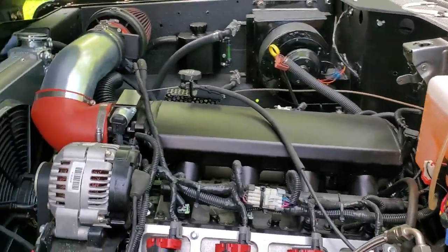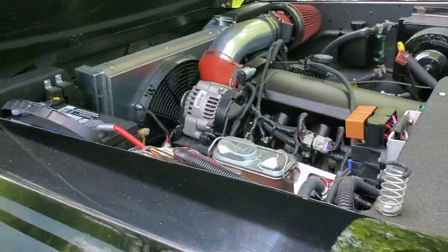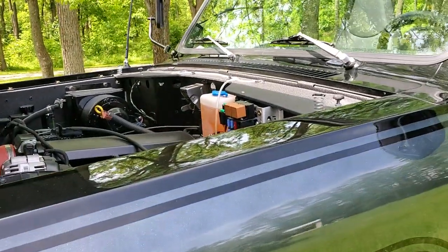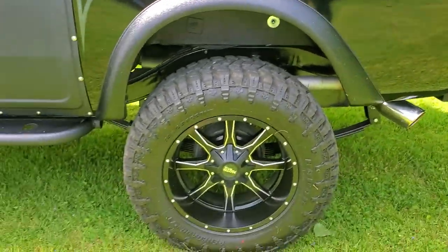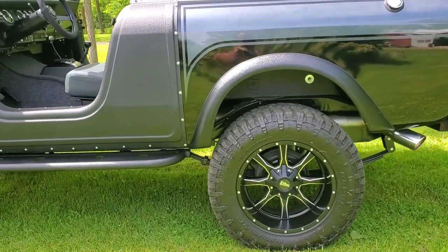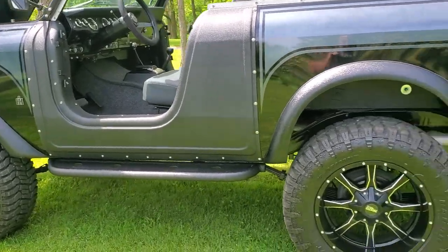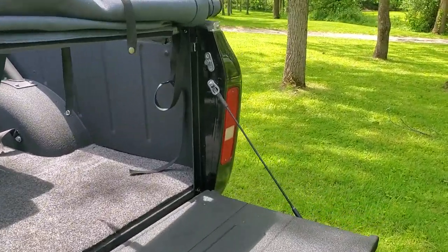There are lots of little upgrades on this truck. Little things like a hydraulic strut for the hood — does away with that factory hood prop. We relocated the axle, slid it back slightly in conjunction with aftermarket heavy duty Rough Country shackles and four-inch springs, which allows you to run 35-inch tires without doing a spring-over. I also corrected the steering geometry at the same time, putting in a heavy duty drag link and tie rod, with all rod and heim joints in stainless steel.